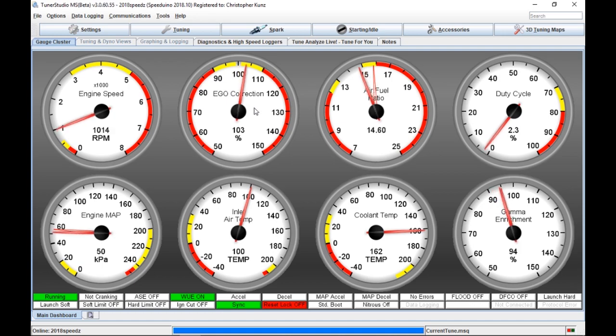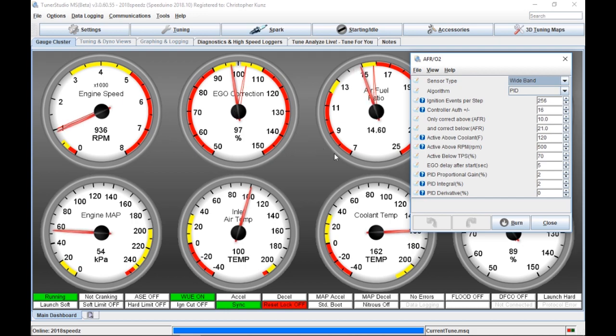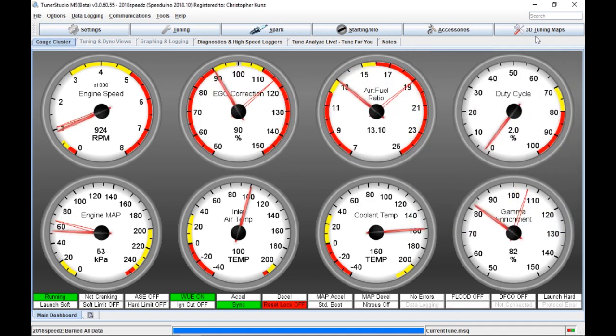The other thing that was kind of goofy is it's way too hyperactive and I couldn't figure out why. So normally with the PID settings — and I did a little video about this with my idle control valve — the I, the integral side of it, is its ability to actually hit its target. As you're putting in numbers there and it's aiming for the target, that is the key number to say, can you actually reach the number you're looking for? What happens is if the number's too low, then it won't ever correct enough to get to that number. Let's view this kind of like a car.